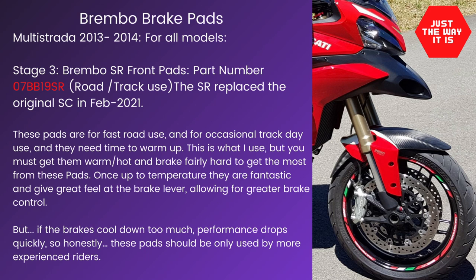For the vast majority of riding they're fine, as long as you're aware of keeping temperature in your brakes and give it time to warm up. When these are hot they are another step up from the SA pad. However, when I go on tour with a mixed ability group these pads are no good — I actually have to remove them and refit the original Ducati pad, because the OEM pad's operating temperature range is much lower and gives a good even performance across a wide temperature range.